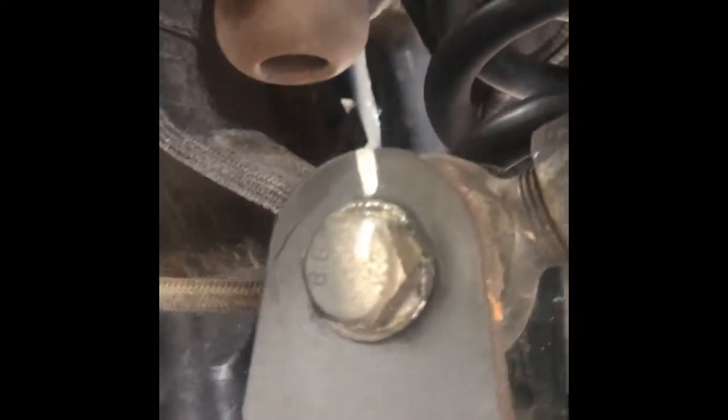So one other thing that's been done back here is they moved the brake lines from outside of the frame rail to on the inside there. So it's on the other side, all up in there. So that's what's going on there. Also have limiting straps, which is pretty neat. It helps prevent you from overextending your axles and dropping the coils. Just have a little receiver.